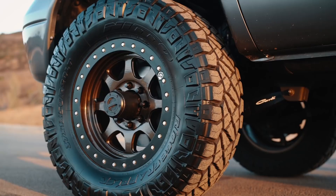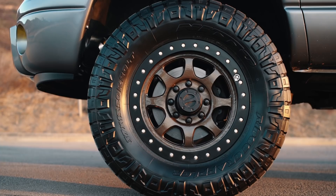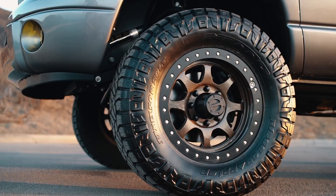The most important part — and I cannot stress this enough — is wheel and tire specs, particularly the wheel specs. You can put whatever suspension you want on, but you cannot fit a 37 without the correct wheel specs. What you will need is an 8.5 to 9 inch wide wheel with plus 18 to plus 25 offset. That's non-negotiable. If you want to go into the negatives, you're going to be stepping down to a 35 or 33. Don't even think about the negatives if you're doing a 37 inch tire on an 03 to 12 Ram.